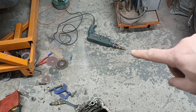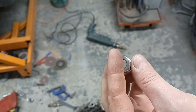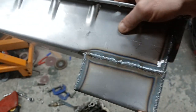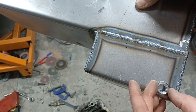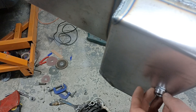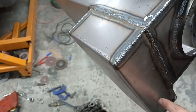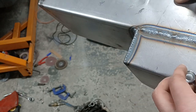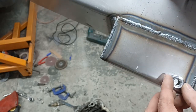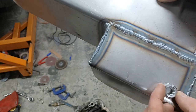You can see my step drill just there - I've taped off up to 18mm where I want it, and that's been faced off nicely. The idea now is to put it in there. Underneath would be better obviously for the oil to empty out, but it will stick out a bit because this is where the bottom of the bell housing comes to, so I don't really want bits sticking out the bottom. The back of there is ideal - to get all the oil out for a proper oil change, just jack the car up so the front is up and most of it comes out. In reality you never really get it all out anyway, but that'll do. So I'll mark that up and drill that out.